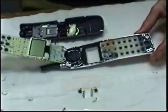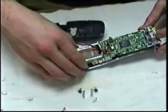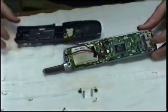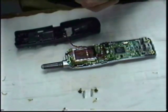Once your board is secured, fasten the back housing to the front, which is done by simply tucking the wires back into the phone and applying light pressure back to the fasteners. They will click on their own. Lastly, return the final screws to the back of the battery compartment and install your battery and battery cover.